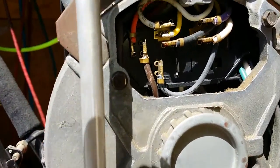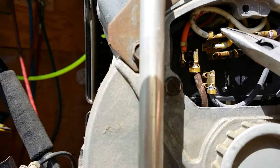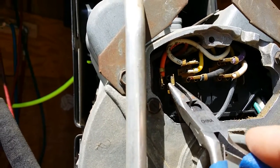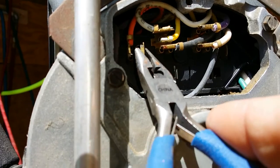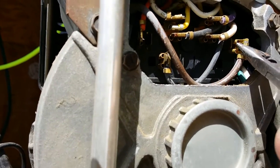This compressor is currently wired for 110V. Above each terminal there's a little plastic marking. Find the brown wire attached to terminal 1, next to the orange wire. Pop that one off and move it over to terminal 7, below the purple one.